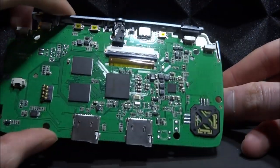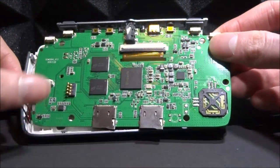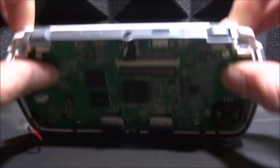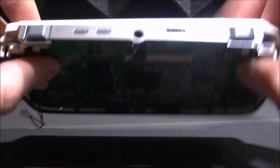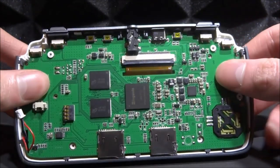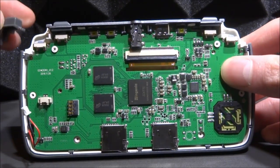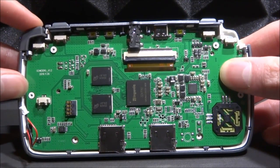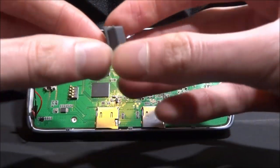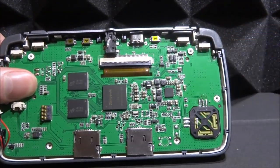All the buttons and everything are back in place. Now get the motherboard and gently clip it over. Make sure to get the speaker wire out of the way so it doesn't get stuck, and it should just clip in nicely. Once it's on you can hold it quite solid. Press in your buttons to test them, test the D-pad — everything seems to work fine. Now put the screws back in, put the analog stick back in when we're done, and we've also got the shoulder buttons. Make sure you get left and right the correct way around and check that they work.